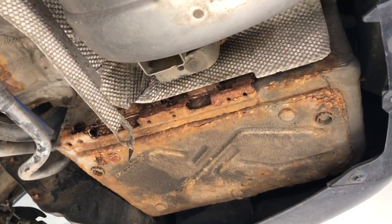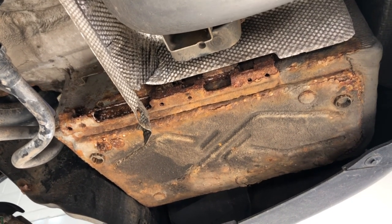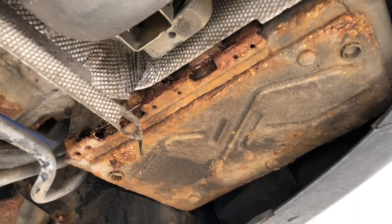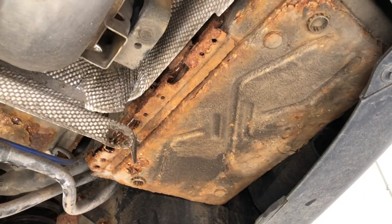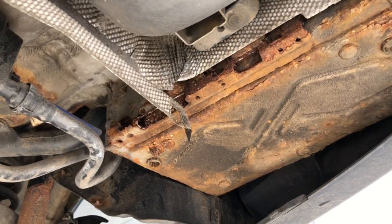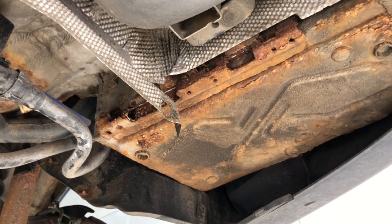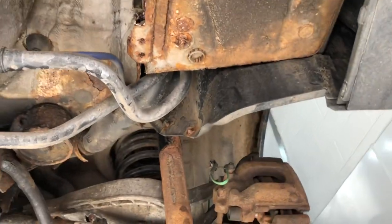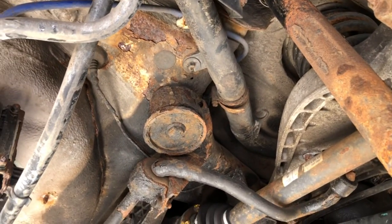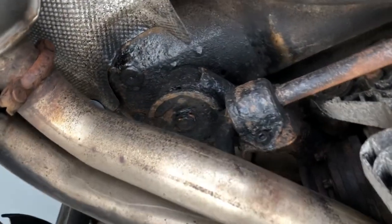All cars seem to be quite different. Some cars don't suffer with much at all, but still have corrosion. I don't think I've seen an E46 for many years now that hasn't had some form of corrosion, but some are worse than others. Some seem to get more corrosion if they're coastal cars or have done some heavy winter work with lots of extended usage of salts on the road. This car, being a 2005 with only 74,000 miles, has a decent amount of buildup corrosion.